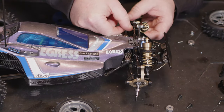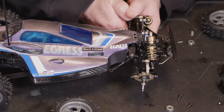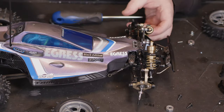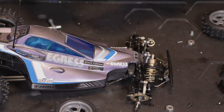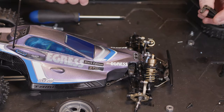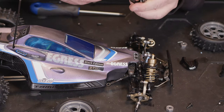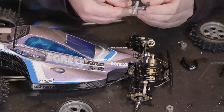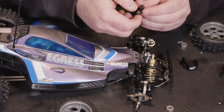Then you should be able to pop your steering arm back on. Then we've got to pull the other kingpin bolt back in, so we may as well start with the other side that way we're not flipping it over and losing that little spacer. First off again, you're going to have to get that little ball joint out.